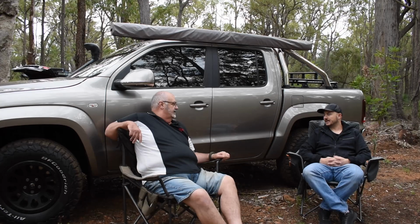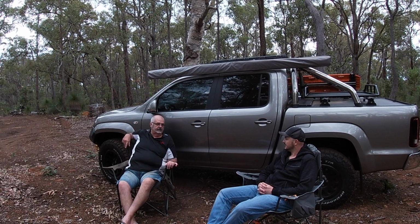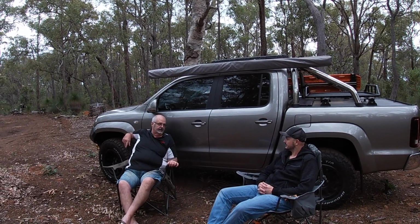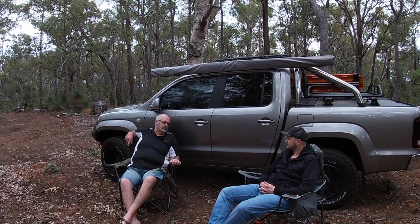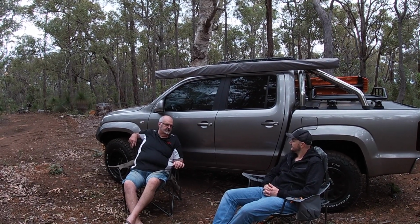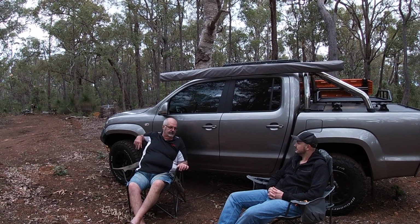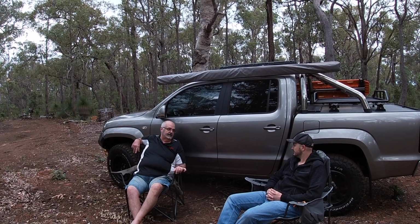It needs a fuel tank protector. Yeah. It's a plastic fuel tank, and it's one of the lowest hanging things underneath. And with the long wheelbase, it's not uncommon for it to get scratched up under there. The sliders will help with that, but still, just for peace of mind and a bit more safety. Yep. Okay. Do you carry around a kit with tank repair bits and pieces? I'm not exactly sure of the name of it, but it's relatively cheap and it does work quite well. Yeah, right. I carry the metal putty in mine, even though it's well protected. The last thing you want when you're out travelling, particularly if you're remote anywhere, is to punch a hole in your fuel tank if you've only got the one, because that becomes a showstopper.